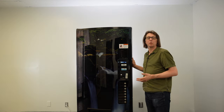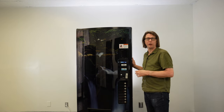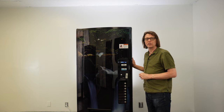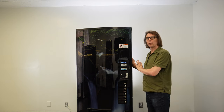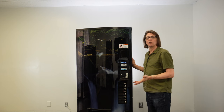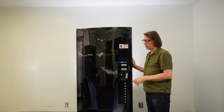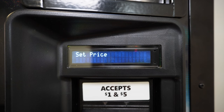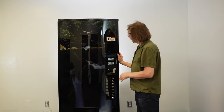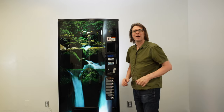If you have any other selections you want to price, simply press selection button two to advance forward or selection button three to go backwards. When you're done pricing, you can close the door on the machine, or if you have any other editing or mode functions you wanted to change, exit set price mode by pressing selection button one, which brings you back to the top level where it says 'set price.' When everything is done, simply close the door and the board will automatically be placed back into sales mode.